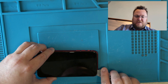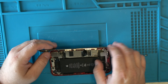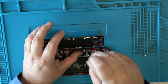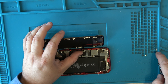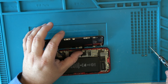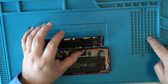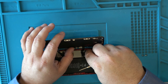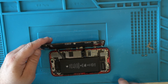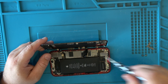Hopefully you already know how to open an iPhone 11. I go around where it's nice and warm, twist up, open it like a book, and move the cables over a little — not too much, you don't want to damage them. Then spatially organize your screws: exactly how you take them out is how they come back in. First, disconnect and verify there's no water damage — we don't see any, so we're golden.